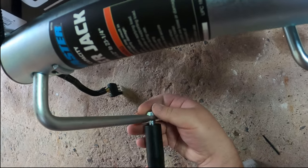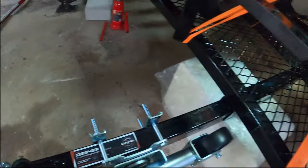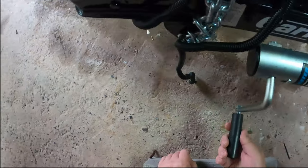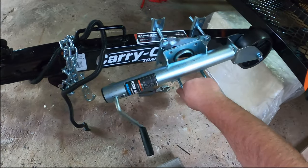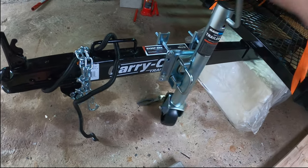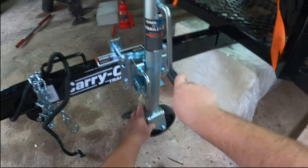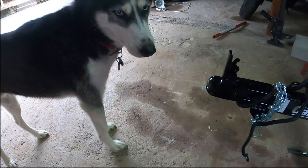One thing I wish this had, just looking at it now, is maybe a folding handle. Like on my motorcycles, there's a kickstand that flips in and out — it's almost tempting to run to the store to find something similar. But basically you're going to pull this, which allows it to turn. This goes ahead and props up our wheel and locks it in. Now if we want to raise this we just start turning, and you can see we're turning the wheel — let's hold that straight and watch this: we are lifting up our trailer.